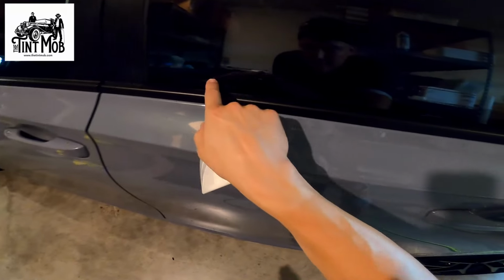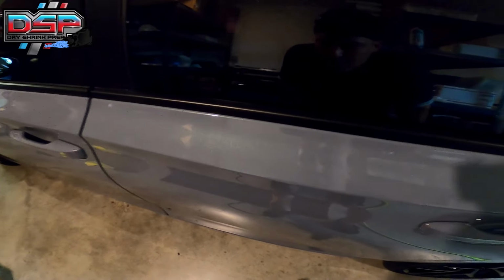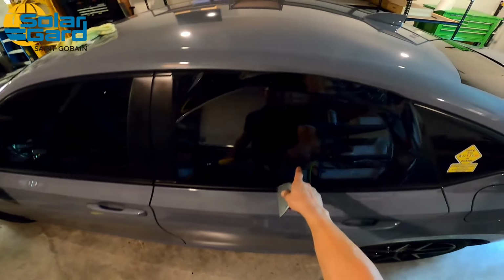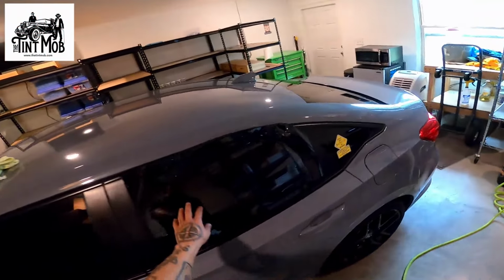And just like that, that bottom rail is nice and flat. Okay, so now you're not gonna have any worries about fingers or popping or anything of that nature. And that's how you shrink a side window. It is a wet shrink. It's a traditional way to do a wet shrink. And that's it. Now you're ready. We'll move on.